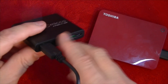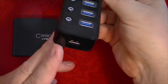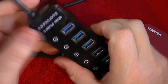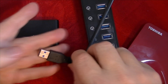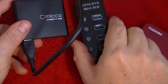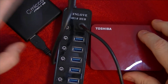I was wondering if there just wasn't enough power being supplied to the hard drive from the Mica. So what I had to do — and I highly suggest doing this — is getting a powered USB hub. A USB hub that has its own power supply that can charge things as well as handle data throughput. When I used the hub, luckily the Mica had no trouble recognizing it, and then I was able to hook up the Toshiba to the hub, and it works perfectly.